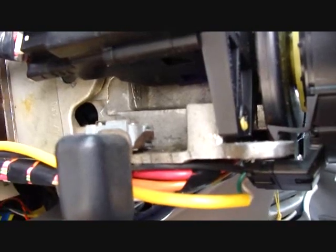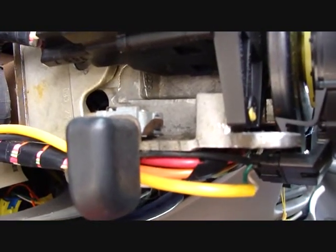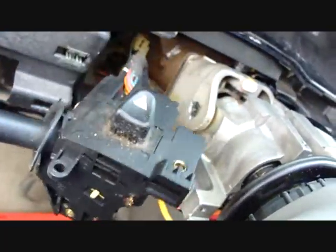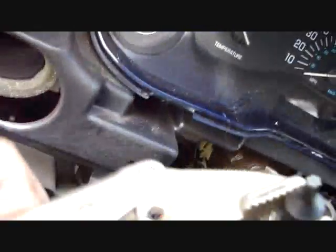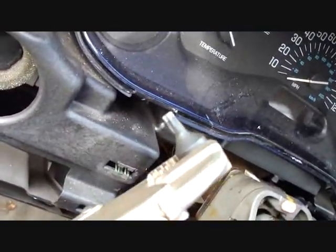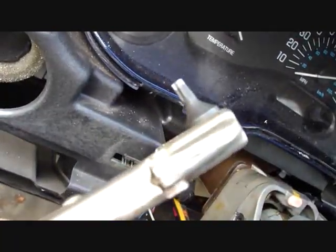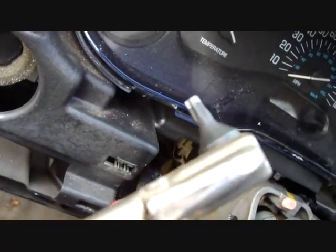So it's actually only 2 bolts that hold this thing on. There's the second one with the yellow paint on it, and that other one in there with the yellow paint. So I'll go ahead and figure out how I'm going to get that one out and take them out, and it should be pretty straightforward. Well, she's off. That was actually easier than I thought it would be. All I did to get that other bolt off was I took a pair of vice grips with a 1/4 inch drive ratchet socket for a Torx 25. That's it. Only had to turn it about 2 full turns until it was loose enough to take out by hand, and that was it.